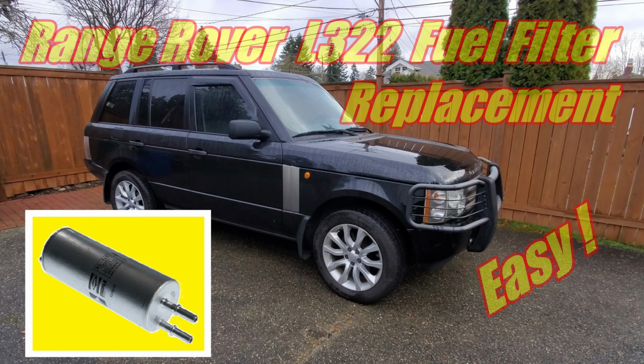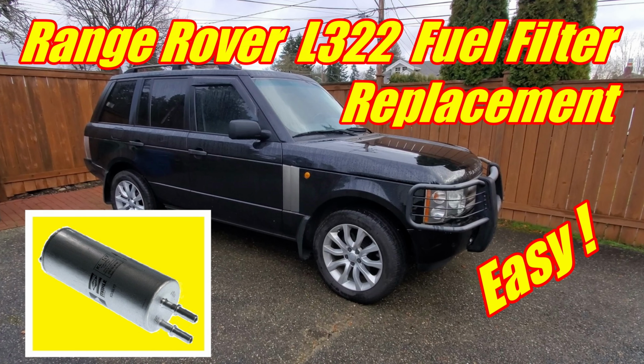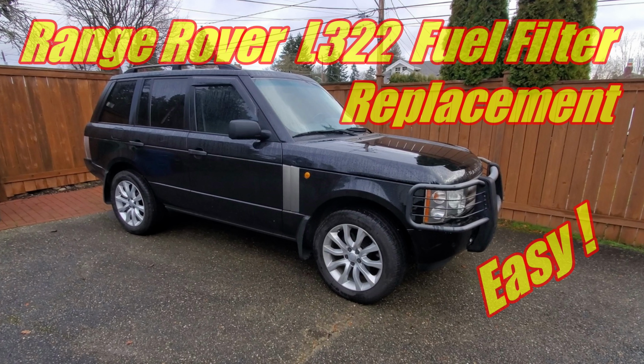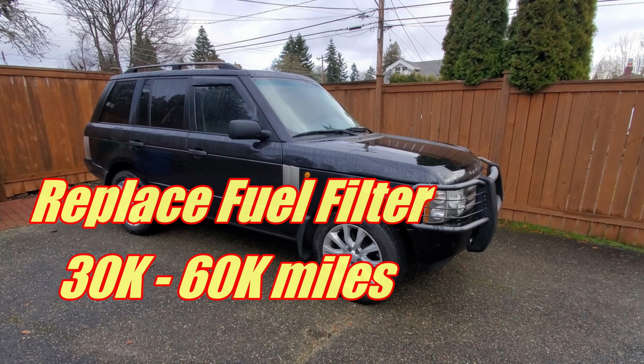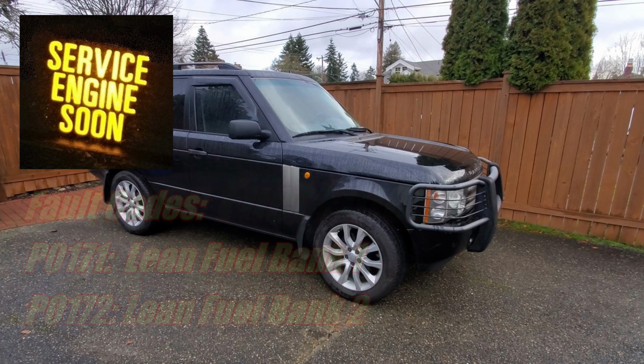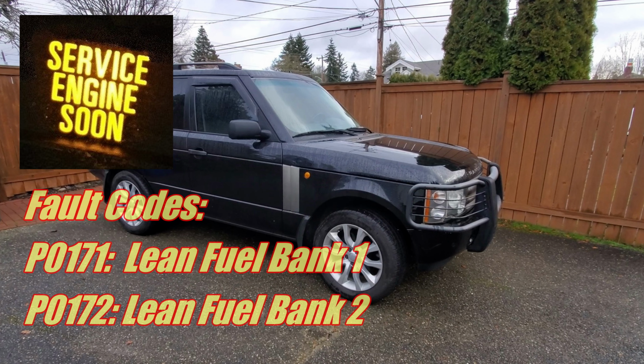In this video, I'll show you guys just how easy it is to put a new fuel filter on the Rover L322. It's first generation, same as a lot of the BMW X5s. And if you don't have symptoms, it's a good maintenance just to replace these. But if you do have symptoms of a clogged filter, you might have hesitation, you might have some fault codes